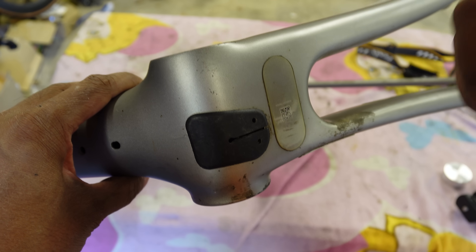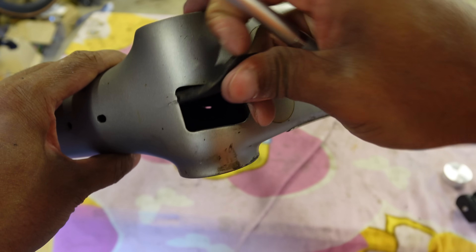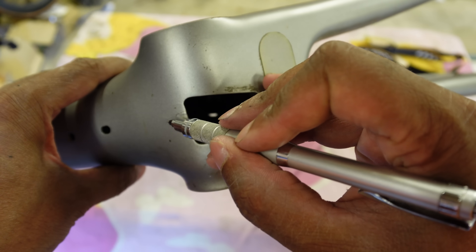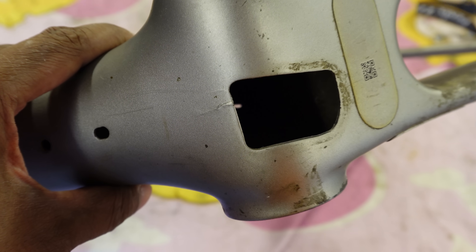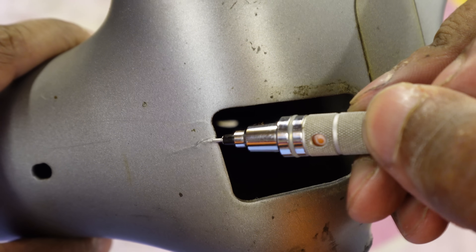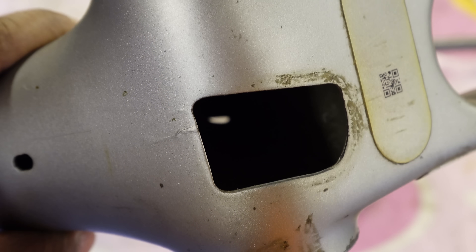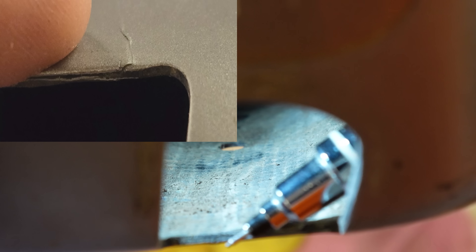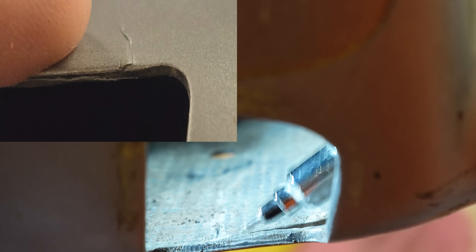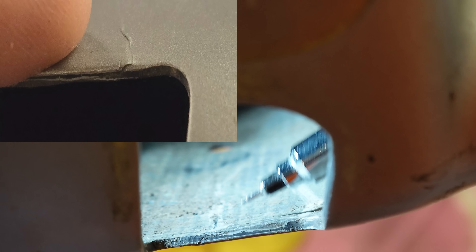The owner wanted a bottom bracket to bridge from the undersized side to the oversized side, but I told him that wasn't a great idea — because here there is a crack. You can see it starts here and ends there. Zooming in: it starts there, goes there, and you can see the paintwork bubbles slightly. It's obvious to the naked eye that that is a crack. Inside, with the gear cover taken off, there's a white line visible here. This side and that side have a joint, and the crack runs right along it.